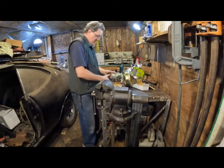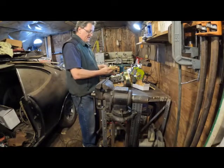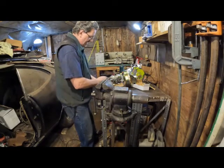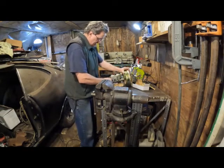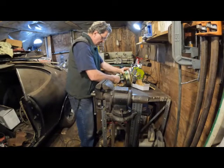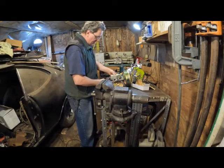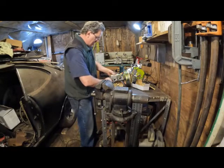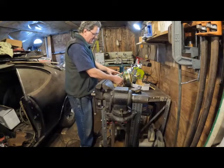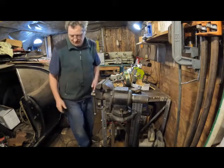Some things about this. This here is your proportioning valve. You have these 2 things which are made up. They weren't bent exactly right, the one in my kit. What I did was the bracket that holds this, I took it to a local shop and had them weld up the bracket rather than trying to bend on these lines, because these lines can get brittle and crack if you try to adjust them too many times, and then you can't use them. Or you may not know that they're brittle and cracked, and you use them and you hurt yourself with a car crash.